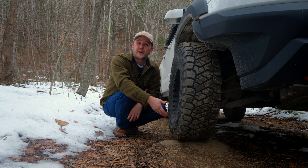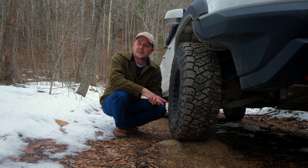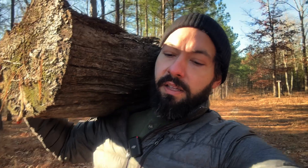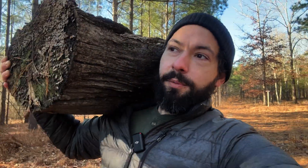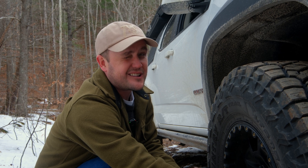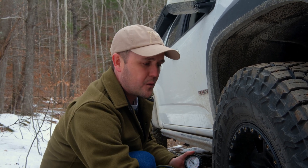Also, if you're on really rough gravel washboard, maybe going a little bit faster, this is going to absorb just a little bit more if your suspension is not tuned for that kind of fast-paced travel. In that first shot, it wasn't very clear on camera the difference I was making. We definitely thought that when we got to lower pressures it would be obvious, so we're going to go down about 10 more from 25 into the 16–17 range and hit that same rock one more time.